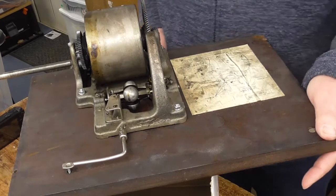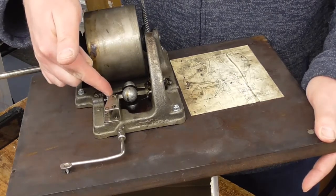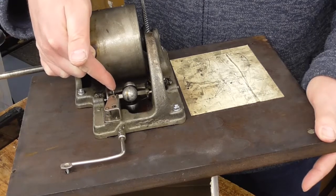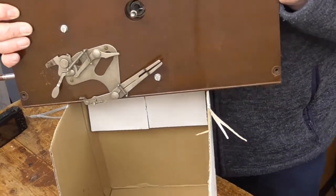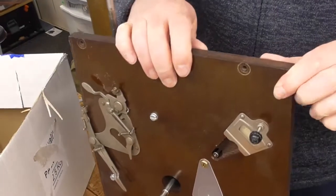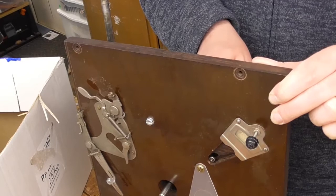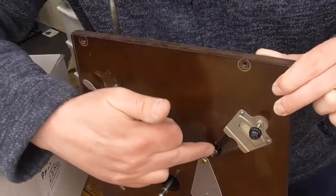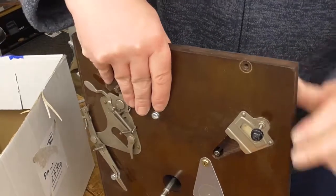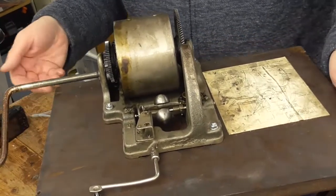The other thing that confused me, and I've got another little video where I actually show the adjustment of this, was this follower here. Well, I call it a follower. It's like another little brake, and through a mechanical linkage, it links to the speed dial. Probably not going to be easy to see. As I adjust this little lever on the back, you should be able to see the needle in there move. Now that wasn't showing the right speed even when I did get it running at 78 RPM, so it took a little bit of thought to figure out what was going on there.